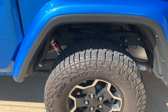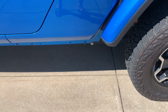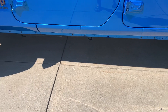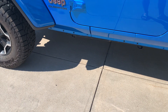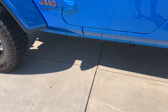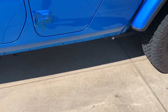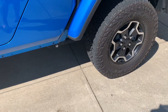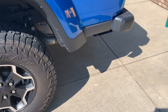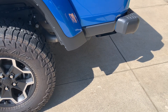I have a few little rust spots starting to show on the frame. I'm not going to worry about those now — those might be a next year cleanup. What I did is I pulled the sliders back off because most of the holes for the sliders I had to open up, and I put some body touch-up paint in there. But since I'm going to have POR-15 out to clean up this bracket, I wanted to put it in those holes because it's going to be a lot better than just the body touch-up paint. A couple of the holes on the other side were a little tight, so I'm going to open those up some more. I'm planning to drill out those holes, clean up the things I'm going to paint, and then get some paint put down.